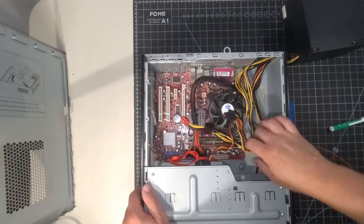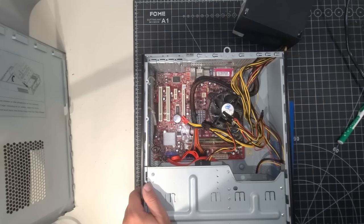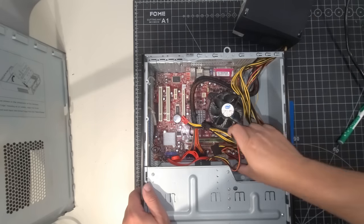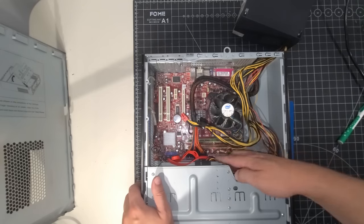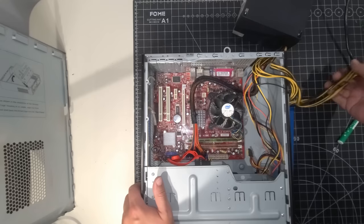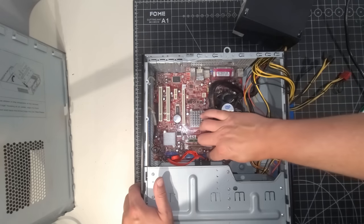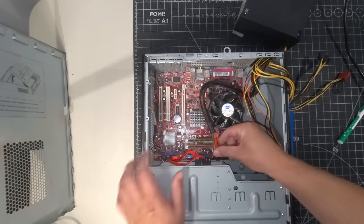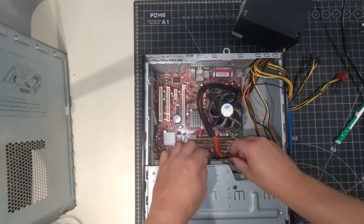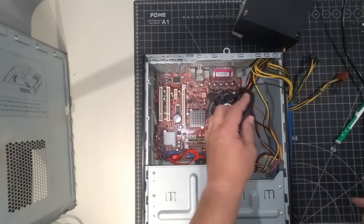All I've done here is fish the wires for the power supply through the back where the old power supply was. This power supply is quite large with long cables, so it does have the ability to do that. This is only temporary until I can get the other power supply that we took out repaired, because it is proprietary to the system. The more I look at these caps, the more and more bulging they are — I definitely want to get that sorted out.